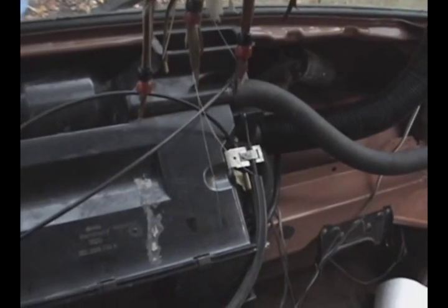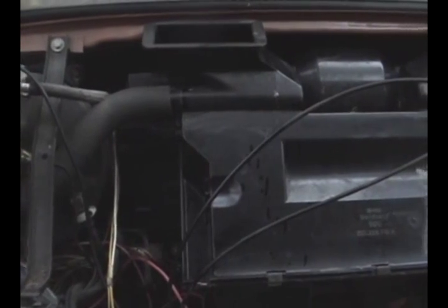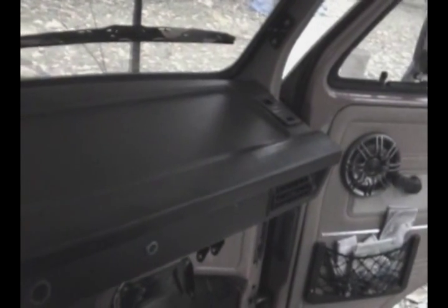Don't forget to put the ground back in the ground block. All the vents are back in, it's been cabled back up and wired back up. What I've done is put the dash back in with just two screws to hold it. Watch out for these braces down here. I roughed in all of my electrical jacks and put all my vents in. One thing I discovered is a lot of items on the dash have little light bulbs — you might want to arm yourself with a bunch of little replacement bulbs if you want to get them working again.